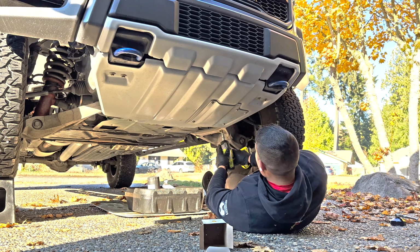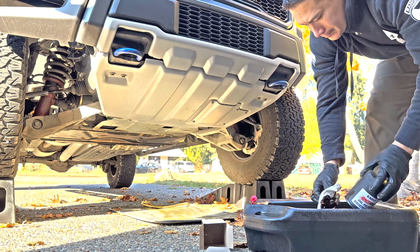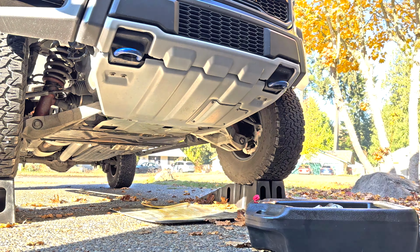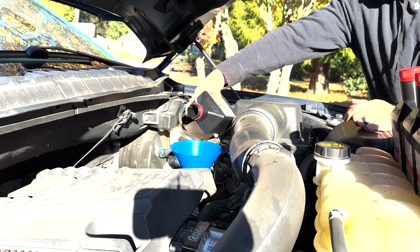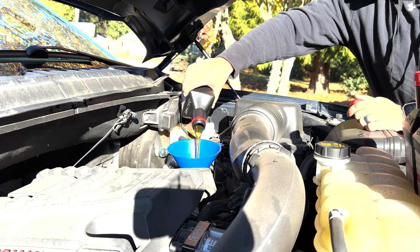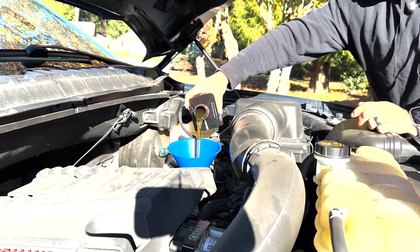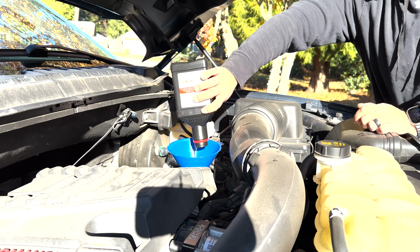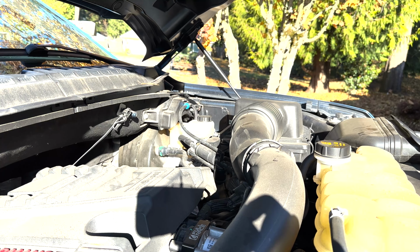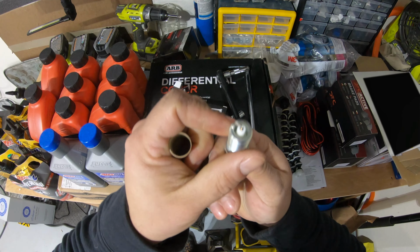I think it's very important to do oil changes in 3 distinct steps. There's the drain portion. Once you're done draining, you seal back up the oil pan, whether it's a drain plug or a valve, whatever. You seal everything back up, you cover back up. When you're done with the oil filter, you do the same thing. That way, when you do it in those 3 steps, and this final step being the fill step, you're not worried about, oh, I forgot to put the drain plug in, I forgot to torque down the oil filter. Just 3 steps all in one, in that order to make sure that you're doing everything properly. And then once you're done dropping in the 6 quarts of oil, that's it for the oil change. Turn the vehicle on, back out, and then move on to your next project, which for me was the spark plugs.